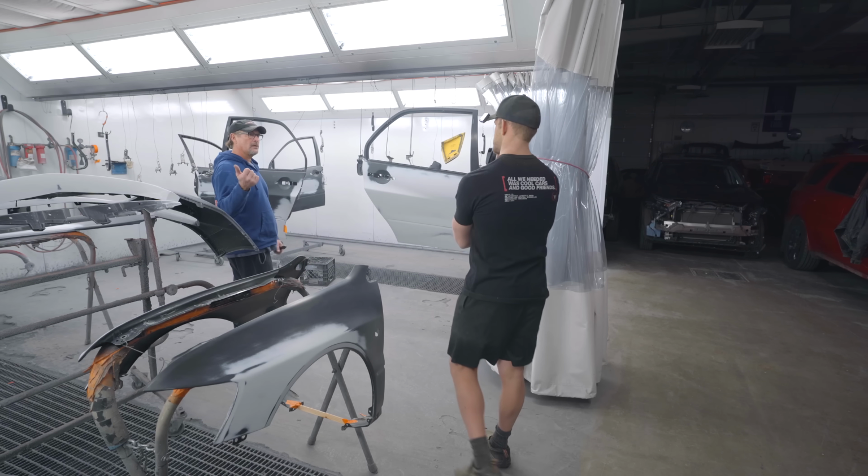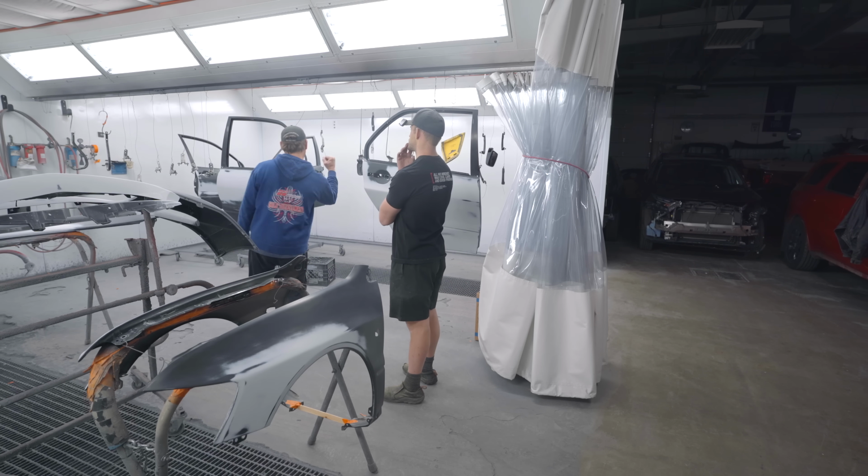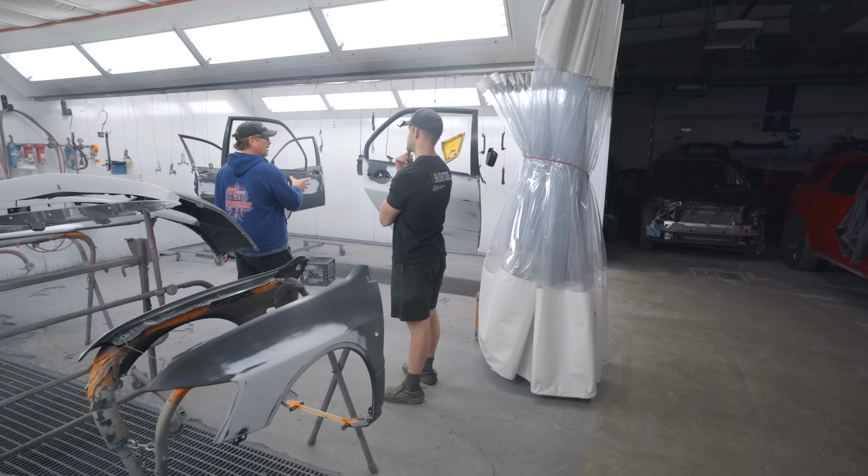So you know how Rob was talking about the tri-coat yesterday? Let's say you're spraying your jam here, and you're getting a coat on the outside. If you have too many coats here, it butts up to the door, or this is actually the quarter. It's not gonna match because it's transparent. Whoever paints the doors and fenders has to paint them, and not somebody else.